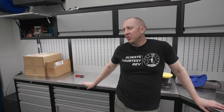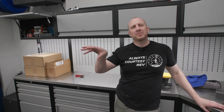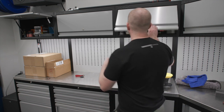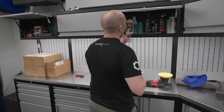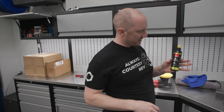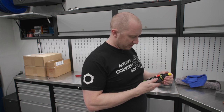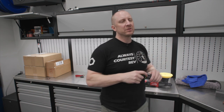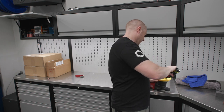Theoretically, polishing will remove some of the top coat, so any hydrophobic capability of this paint protection film we're going to damage. But it's ruined anyway, so we might as well try to restore it and fix it — save myself a bunch of money. The plan is to just apply a little polish and see what happens. I'll try this first — DA Fine from Rupes — because this is a finishing polish, whereas Perfect Finish is a combo with a little cut and then finish.